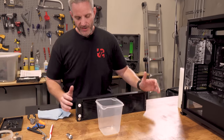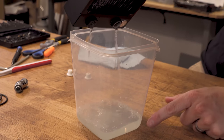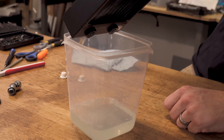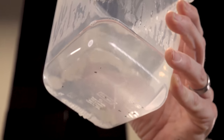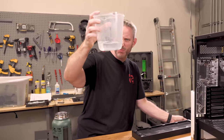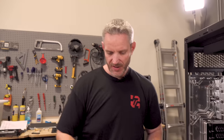What we're going to do now is drain it — pour it out and look for any sort of a green tinge, which we have, as you can see. That tells me we've got some corrosion. Look at all this stuff falling out at the bottom. We're going to repeat this process more than once until I can get this coming out about as clear as possible. After three, four, then five flushings, most of the sediment's gone — still slightly blue, still a little bit of that black stuff. So I might just go ahead and hook this inline filter up.